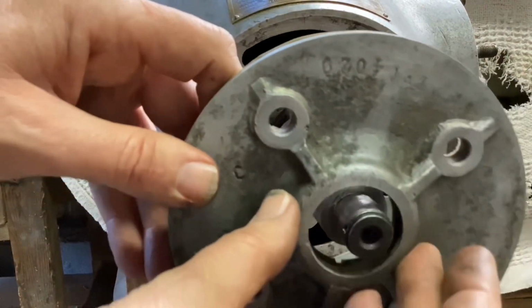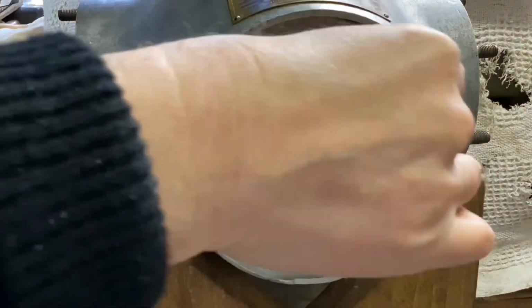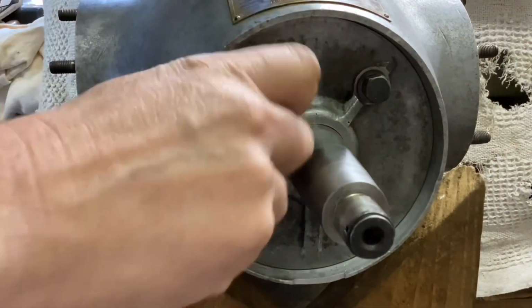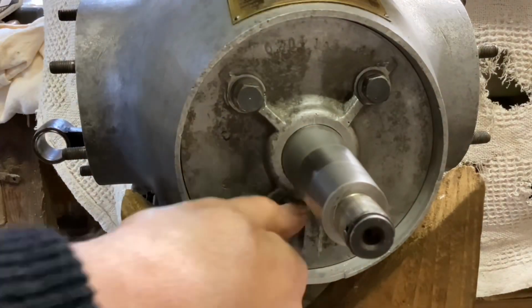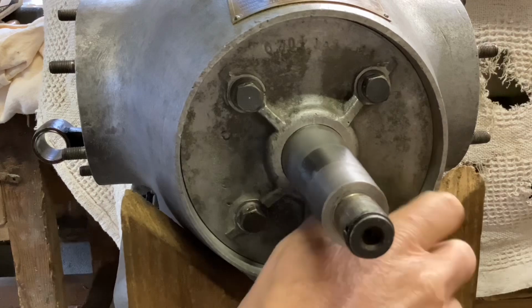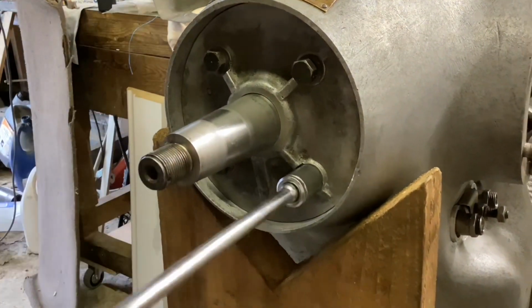The thrust plate goes on with the gasket behind. I cut one out of the Flexoid paper. Once the gasket is bolted up tight, it's important to check the rotation of the crankshaft. If the crankshaft feels in any way stiff, then fit paper shims or even another gasket. I had already tried this and it felt a bit tight, so I fitted a second layer of Flexoid and it was fine.